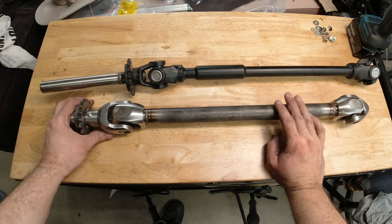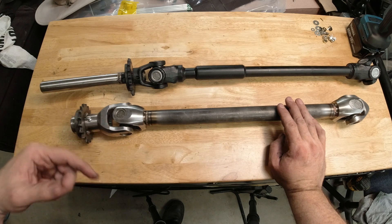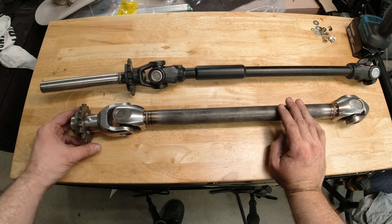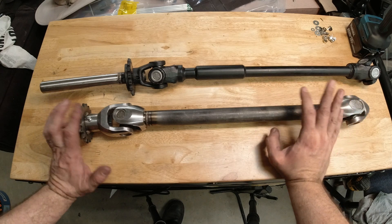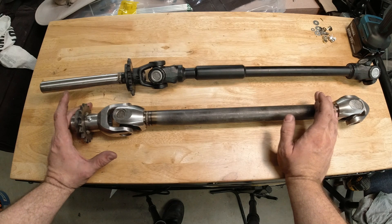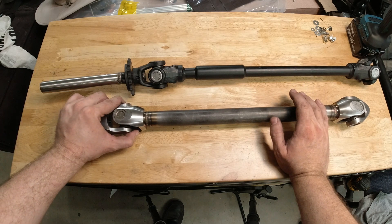So I think that's where the majority of my vibration came from — fingers crossed. The new assembly uses a slip yoke which is splined for almost two and a half inches. We took a 40B18 sprocket, bored it so it slipped over the slip yoke, and welded it to that. The new assembly is almost a pound lighter than the old assembly but overall offers much better engagement in the upstream drive area. Let's get to work.